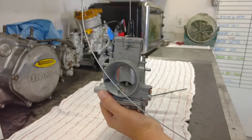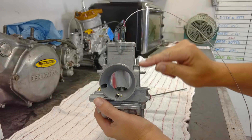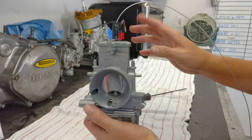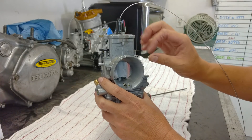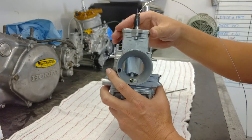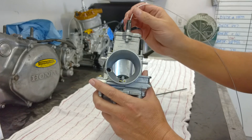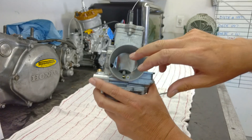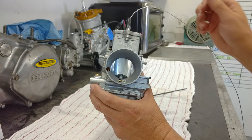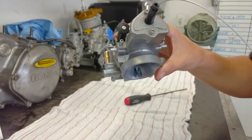That metal-on-metal sound means the slide is going all the way up. When you set this up on a go-kart, you don't want the throttle cable to be completely piano-wire tight on the chassis. Because if you hit bumps or go over curbing, you have a chance of breaking the throttle cable. You want a little bit of slack at the very end. So if you're new, pull the air filter, set it to full throttle, and make sure the throttle cable itself has a little bit of play — not a lot. We swap out the tops to Allen bolts, which we have on shopsweettech.com.